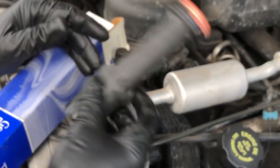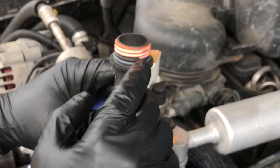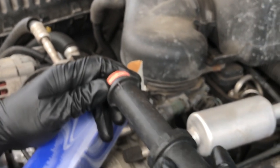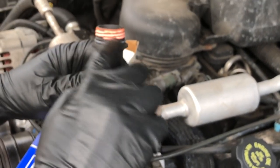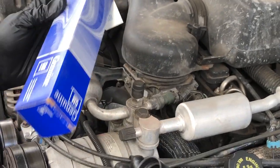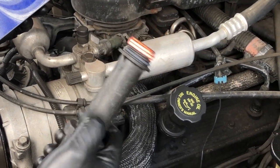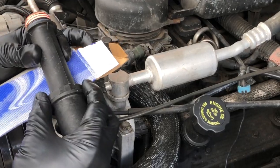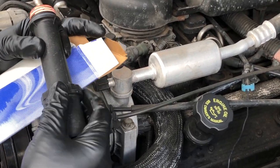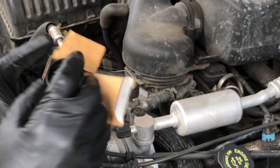What you end up having here is a round O-ring seal — this is what keeps it from leaking. There's a little bit of sealant for the threads here, but when you screw this in, if you get it in snug, what prevents it from leaking is this O-ring. Now they don't service the O-ring separately — they intended for you to buy this whole thing if you needed an O-ring. But typically you'd only buy one of these if it was cracked or if the flats have been chewed off. Usually you should be able to pick up an O-ring separately at an auto parts store.